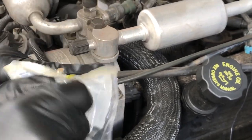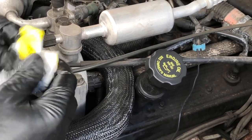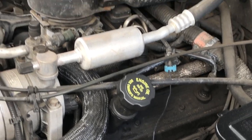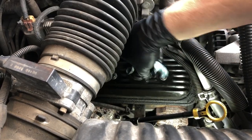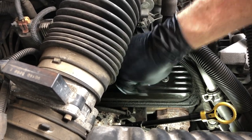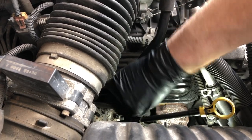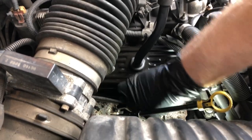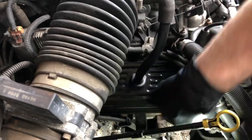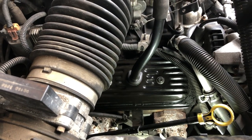So what I'm going to do next is just clean up the mess, get it off the valve cover so we don't have anything falling in. Then we'll pull these two grommets off and replace them. I'm just finishing up cleaning this passenger side one — this is what we want this engine valve cover to look like all the time. I'm hoping all this spillover down here came from this one grommet that looked like the source of all that.